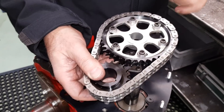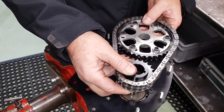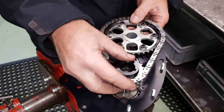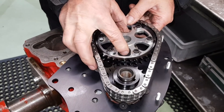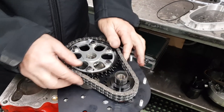We used button heads in the triangular plate just to give clearance underneath the vernier duplex. Here's the steel alloy duplex — aluminium hub, steel gear tracks. Very, very popular item that we sell. It's ideal for fast road engines, even race engines. We've taken the keys out of these two hubs just for ease of assembly. It can be a bit tight to go on, so it's always best to check this before you come to put all this together as an assembly.